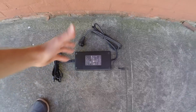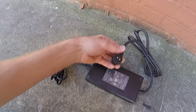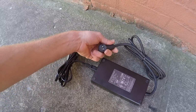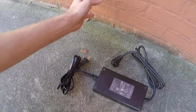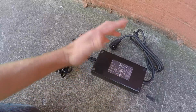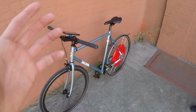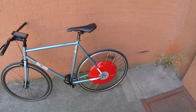And when we're doing that, this is the charger. It's pretty standard in terms of weight, 1.7 pounds. It has that nice magnetic energy bus charger interface, Rosenberger standard, so this can send data as well as power. And if you trip over it, it just pops right off of the bike. Not a problem. Hopefully not going to tip the bike. 2 amp output, it's kind of average. But again, the capacity on this battery isn't really that great. 48 volts, 5.8 amp hours.